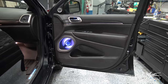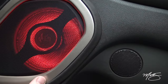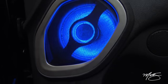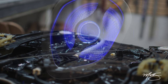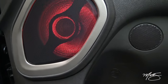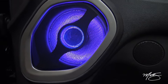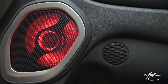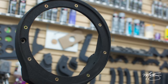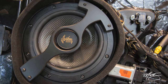These are the front doors, and we had to do quite a bit of modification to get this 8-inch Carbon C8 in here. The Jeep door panels are all molded plastic — basically one big cover that bolts onto the metal of the door. That presents a challenge because it's fully molded; it's not like sheet metal where you can cut the hole bigger, make a flat adapter, and go from a 6 to an 8. I had to make a PVC ring that bolted to the door and fit all the tolerances and variances of the plastic door panel.